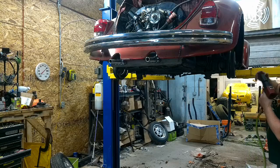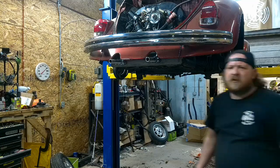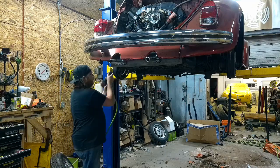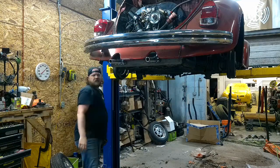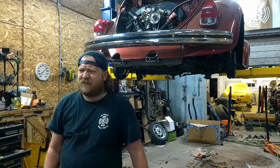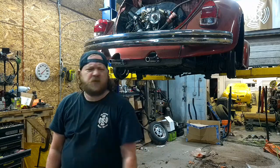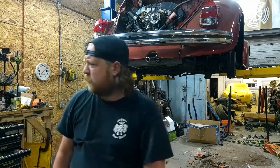Weird spacer. Wrong drums? Huh. They had spacers on them. Never really seen that, so pads and shoes work. I mean, I guess it's fine. Usually spacers are more along the lines of a swing axle, so '68 and earlier with the longer tubes, but this is an IRS chassis. Again, plot thickens with this car.